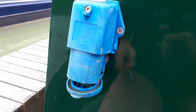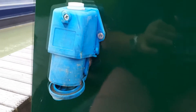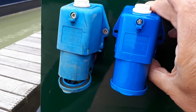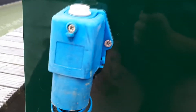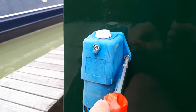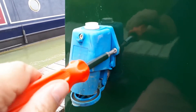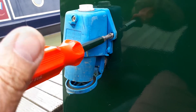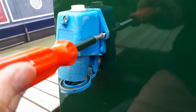Right, okay, this is the old mains power connection. You can see it's a little bit old and worse for wear. If I put the new one next to it you can see the difference, so that'll be a lot nicer. It's just undone by two screws - one on the left which I've already taken out and one on the right. Sometimes these get rusted in, so once I've got them out I'll put some copper grease on before I put them back.